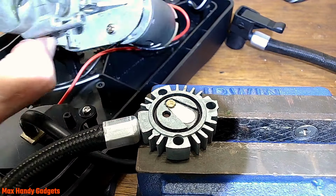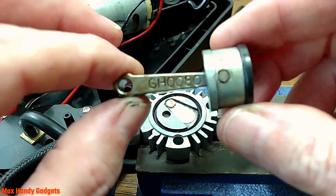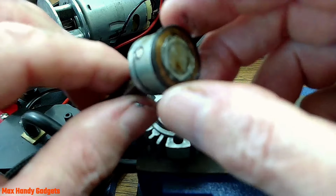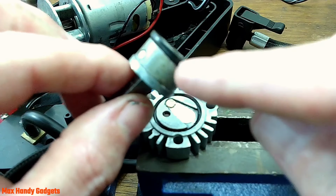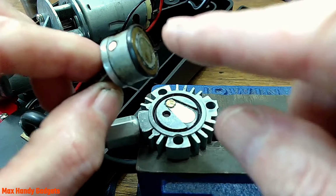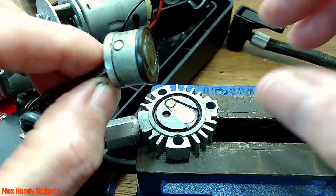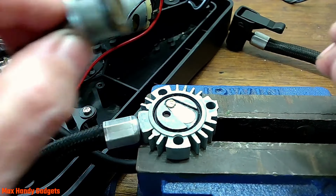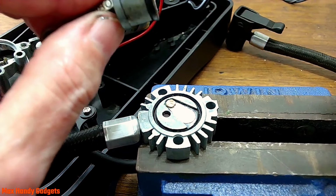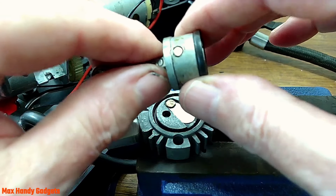Okay, here it is. Look at that little piston. Yeah, it's a little dirty. And there's a little bit of a rubber washer that's going around there that's sort of like one of them little brake wheel cylinders. So it makes air, you know, when it pushes forward. The cup opens and spreads against the cylinder wall and tightens up as it pushes air through. Yeah, that works out pretty good.